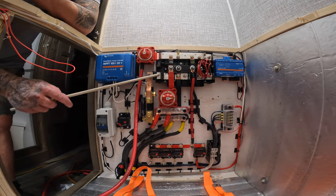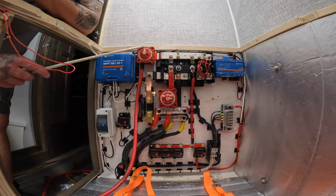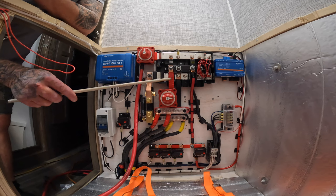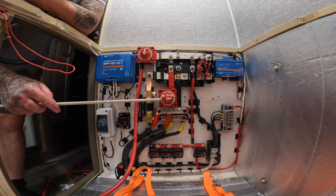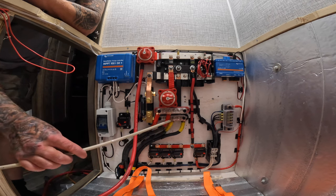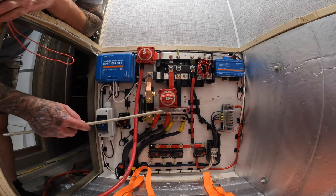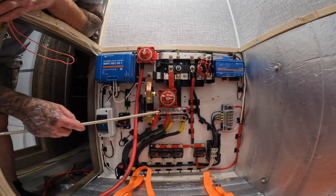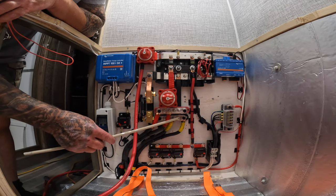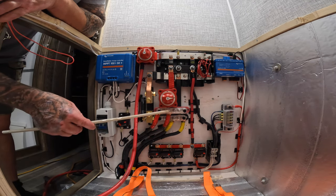Picture this as your electrical panel in your house. The 12 volts comes up to a disconnect, which is bolted right to this bus bar. On the bus bar there's a 300-amp fuse going to this disconnect that feeds down to this power block. The negative is on this side, going to the negative power block. These are parallel runs heading to the other side of the camper where my inverter is. I bring the bus bar off the switch to a screw — one wire on each side of it. The negative goes to this bus bar; I bring it down to one bolt, one wire on each side, with the bar in the middle and the wires on the outside.